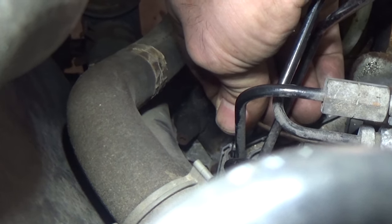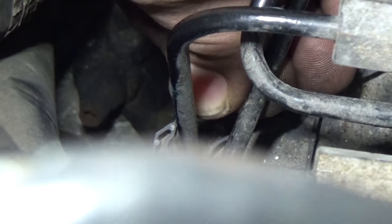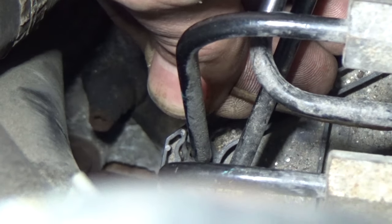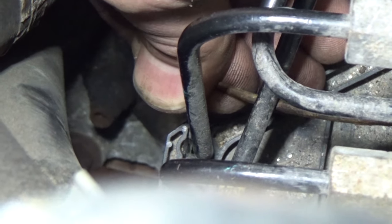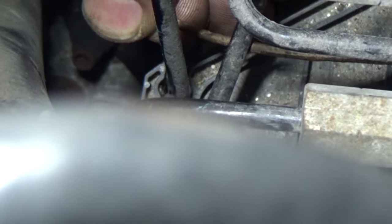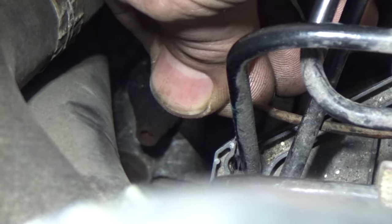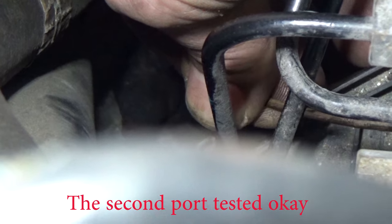That's way over a quarter inch. Let's do that one more time — go ahead and step on the brake and hold pressure. It's still creeping; we can hear it actually. You can hear the spring — sounds like a spring. I'm probably a good — still moving out — still moving, almost an inch, three-quarters of an inch. Look where my thumb is, I haven't taken it off this rod yet. Now we're going to let it off. This should go all the way back. Right where we started.